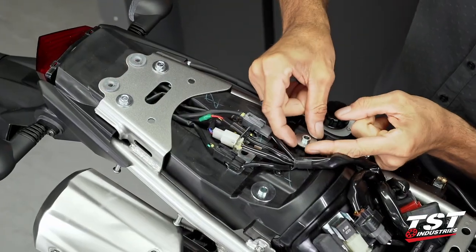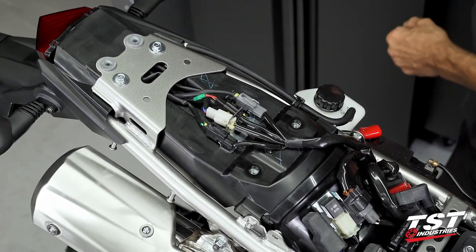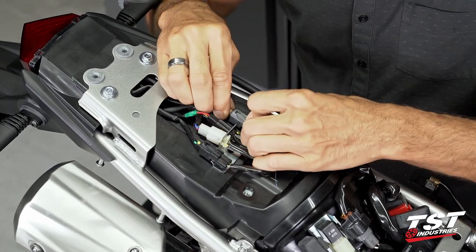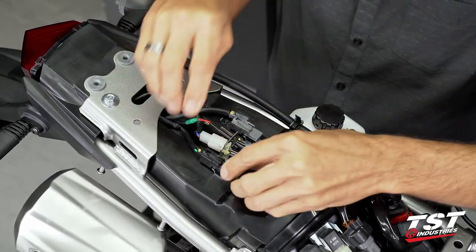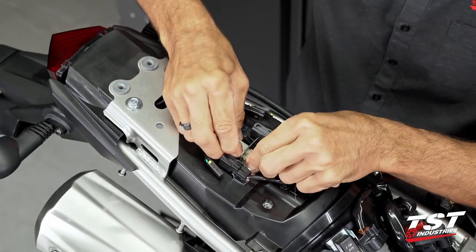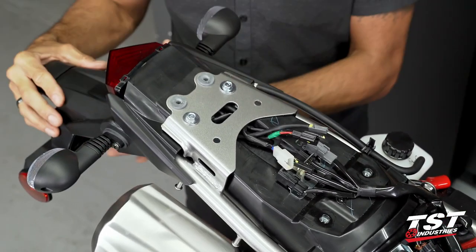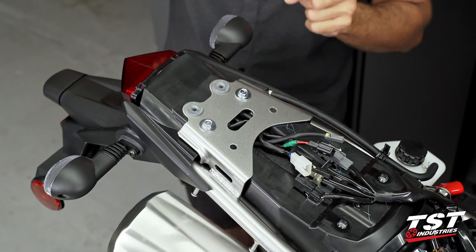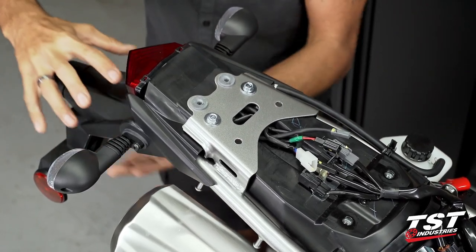Additionally, we want to take these components off for the moment so they don't travel on us. I'm going to group up my fasteners so there's no guesswork later. Now we have access here — we have all the fender lighting equipment connected here. Let's drop these connections. The signals operate via pressing down on this locking element — that unlocks the detent. These MTW Sumitomo connectors have this sort of a lock; you press it down and withdraw it.